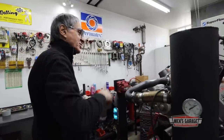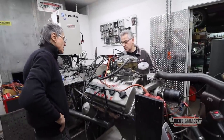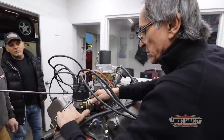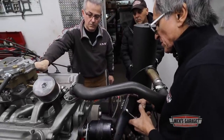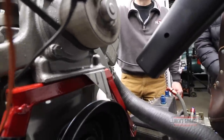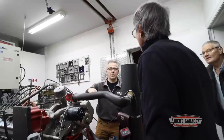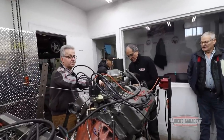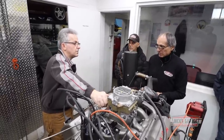Too much to advance, 38 now. But you see it cracking up? Yeah. It's cracking up. I'm gonna put the timing where I had it. It's missing. I brought it to 26 degrees now. Okay. Ready? Yeah. We'll leave it there.